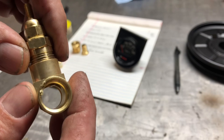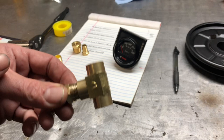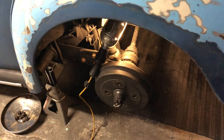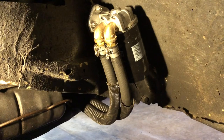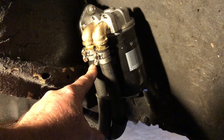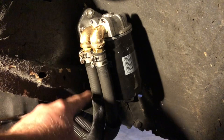So what we're going to do is go ahead and install this T with the fitting over at the oil filter, so the oil will come in, pass through, and go back to the engine, so I'll be reading exact oil temperature. For safety, we have the car up on jack stands. I have the rear wheel removed for your convenience. Right up there in the back fender well is where the remote oil filter is. This line right here is the output going back to the engine out of the oil filter. So we're going to remove this line, remove that 3/8 to half-inch hose barbed fitting, install our T right here, put our barbed fitting back on the other end, and shorten this line up a little bit so it stays tucked nicely.